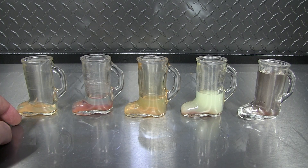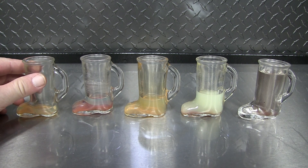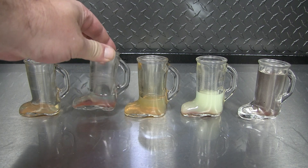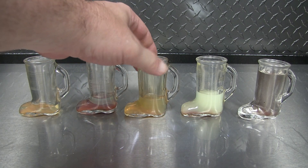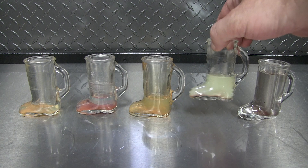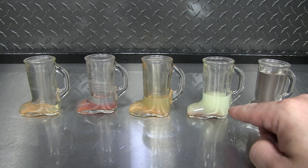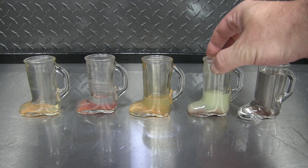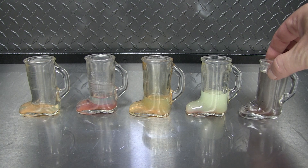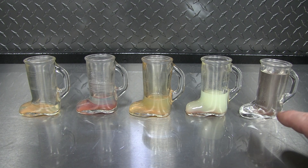This is the last round of flushes — about flush number eight. This kind of came out yellowy and dried up because it's been at least a couple weeks since I did this one. The next time it came out a little orangey colored — you can see the sediment that settled out on the bottom. The next time it came out just yellowy, not too much sediment. And the time after that it was pretty much crystal clear when I drained it — but it clouded up after a couple days, and you can see there's some sediment that settled out. This is today, just about 10 minutes ago — there's a touch of a tint to this, but this is good enough for me. I'm going to go ahead and switch it over to the green stuff, about the 12th flush so far.